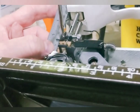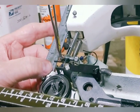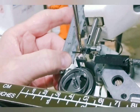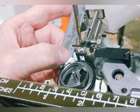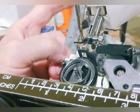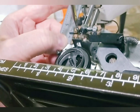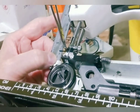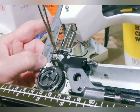We're going to go back to the lowest position of the needle. What we've done is put a hemostat with a black indicator, which is a twist tie — very fancy — but it tells us exactly where the needle position is relative to the frame base, because we don't have their spring-loaded guide. It's now sitting on 14 millimeters, and you're supposed to raise the needle 2.5 millimeters. So there's 15 right there.